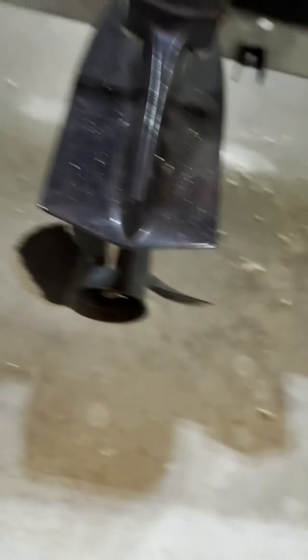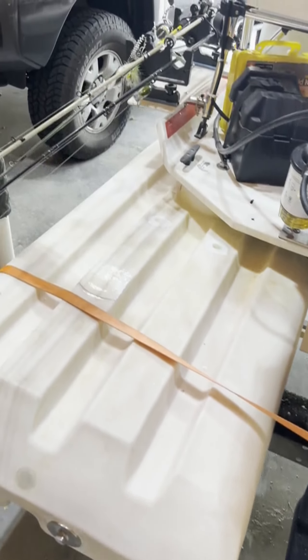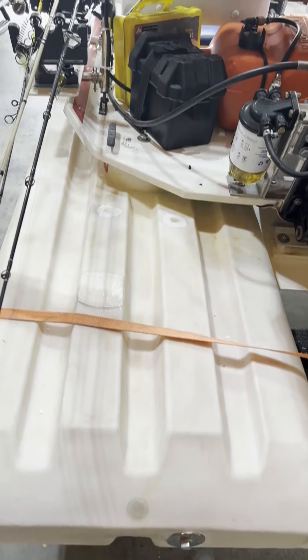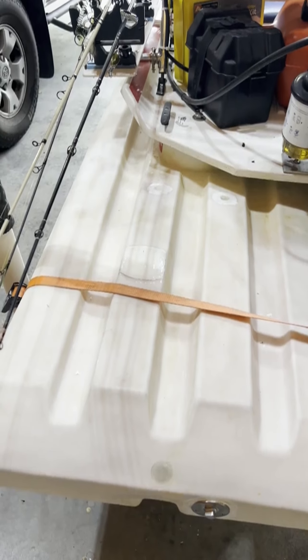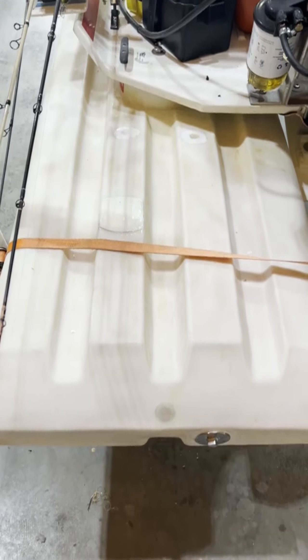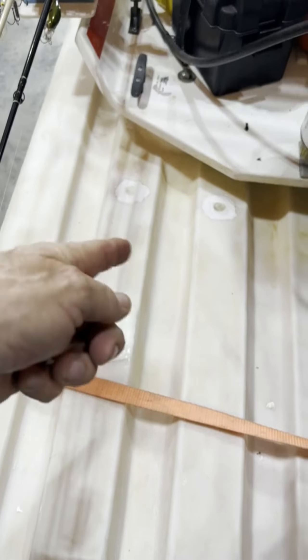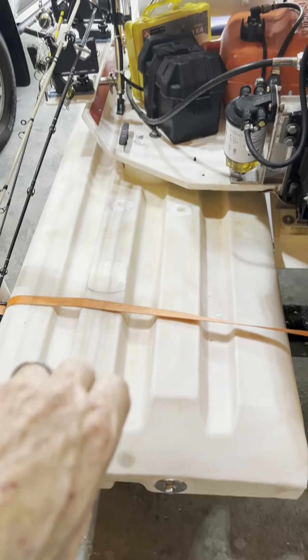The big question is: how did I fix my pontoons? What happened was I had holes in my pontoons right here and a small one over here, so I covered those with E6000 and got that finished. But I still wasn't getting up on plane like I wanted to with two people in the boat — one person was no problem, but two people the engine was really struggling. So I cut a three-inch hole right here, took a pry bar, went in, and started prying all the foam out from there all the way to the back of the pontoon.